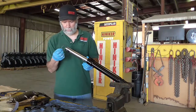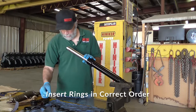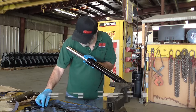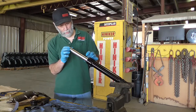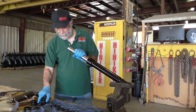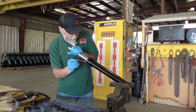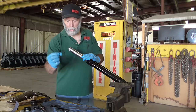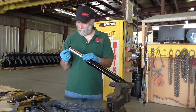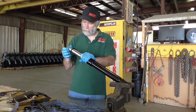We'll give our cylinder rod just a little shot of lubricant to help the seal slide on a little bit better. We'll go with our steel seat ring, then our seal with the flat bottom. Do these one at a time — you might need the help of a little straight screwdriver to get them pushed in to the bottom. Then we'll start with our cupped washers, and the cupped surface goes towards the steel ring at the bottom. Doing them one at a time is easiest.